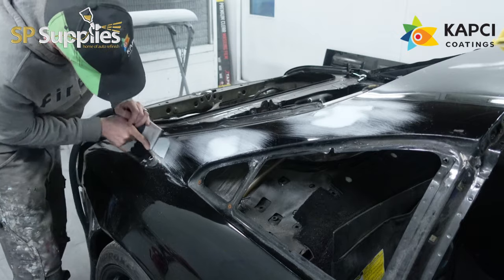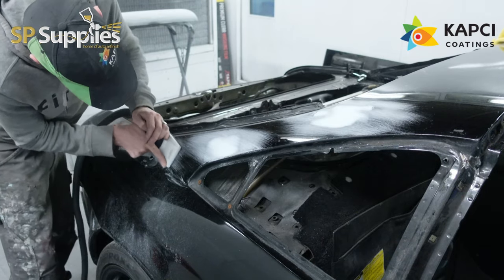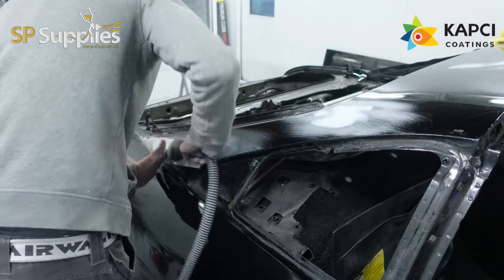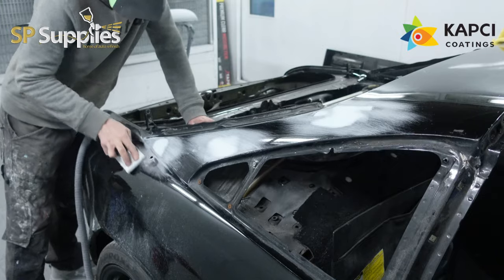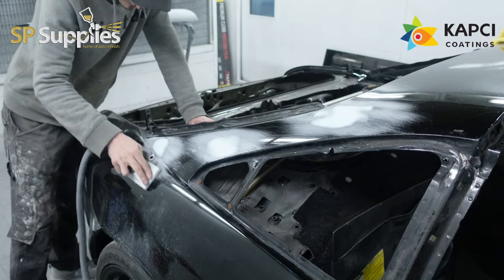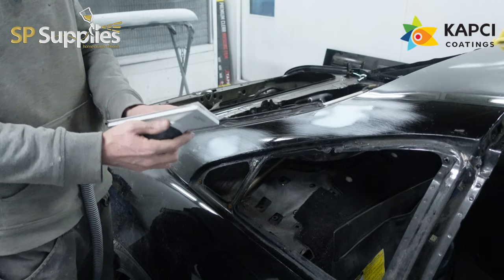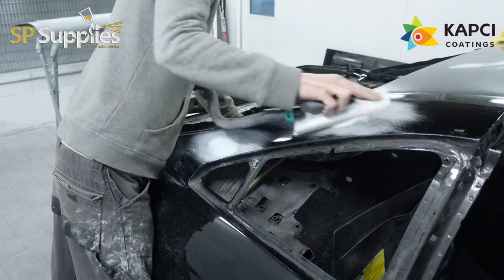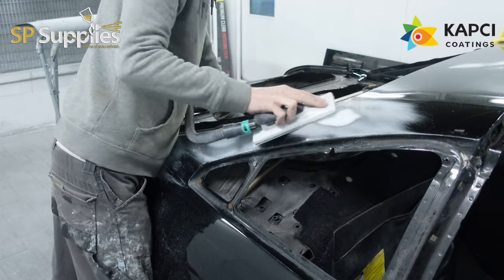I'll go across all these areas with the P80 and then go back across them with a P180. With the 80 I get them to about 90–95% of the way there. If you need a bit more filler then add a bit more, bring it down to about 95% of the way, and then you can start with a P180 to finish off. I'm just going across here where there are a couple of little highs around the bolt holes where the spoiler lip's been bolted on, and there are a few iffy paint edges. I want to block through all those, make sure everything's nice and flat, then take the 180 to refine the repairs, block them into the body nicely, and remove the 80 marks — because any 80 marks are not going to be good when it comes to the primer stage.